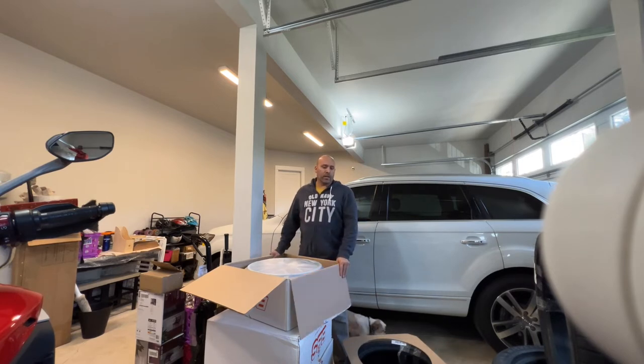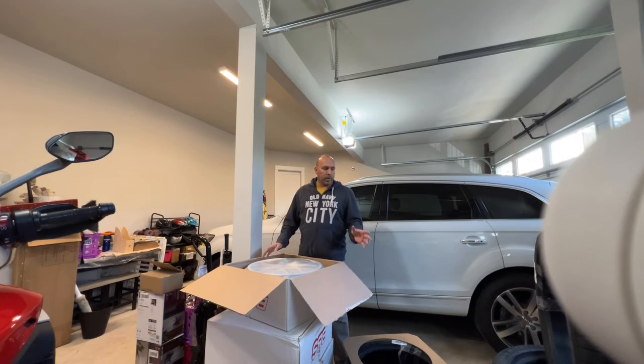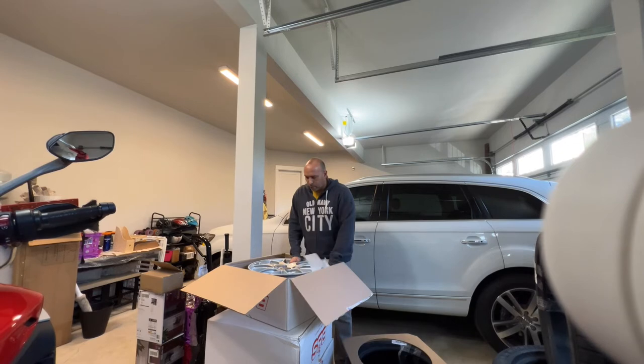The tire selection I chose had the most negligible, minimal speedometer impact. At 70 miles an hour, my speedometer will be off one mile an hour or less with these tires. When I looked at a 315 with a 35-series sidewall, it would throw the speedometer off by a lot more. This selection keeps my speedometer almost within one mile per hour of the original specification.